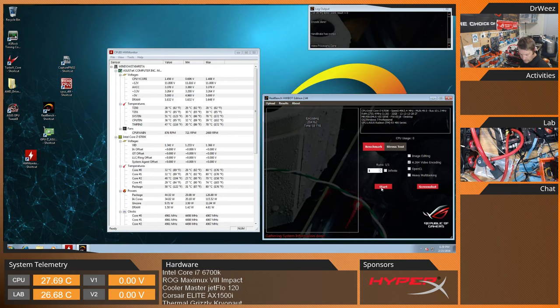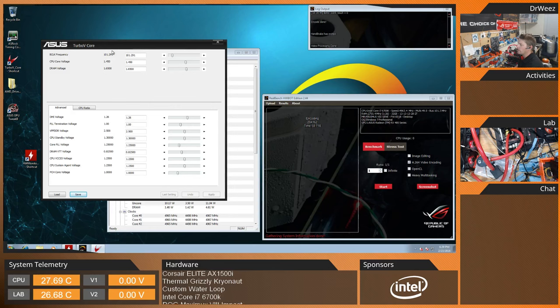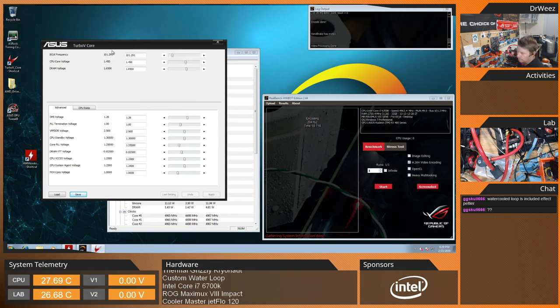I'm getting a little tired, but the replays will be on YouTube tomorrow if you missed anything. If you tuned into the stream on Tuesday and you saw me having some issues with the RX480 Strix, I managed to resolve those issues with the drivers. It turns out that there is a Windows hotfix that is required in order for the new generation of stuff to work properly. That is, in a nutshell, the problem I had.